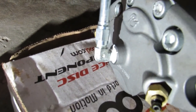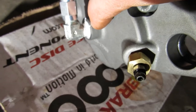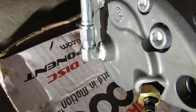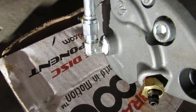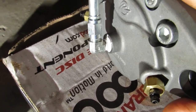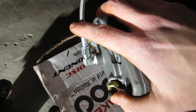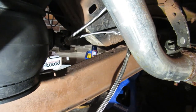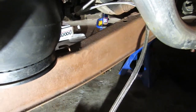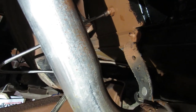Here's what I was mentioning earlier — I'm not really sure why, but on aftermarket calipers it's a thing where they install 1/8-inch NPT threads, like pipe thread. I don't understand why they keep doing it. I've just gotten used to it over the years. If you know why this happens, please comment below — no one will give a good answer, but whatever. As you can see, I've done some thread sealant in there — just a tiny bit to lock down my AN fitting, like we talked about. Another thing I like to do is run a loop in the line up there to take some tension off the fittings, so as the axle goes up and down it can soak up some of that vibration.